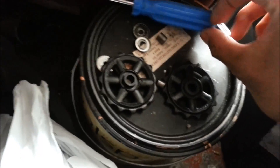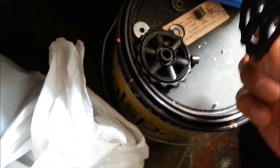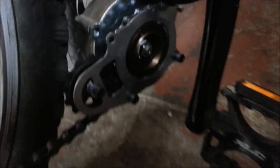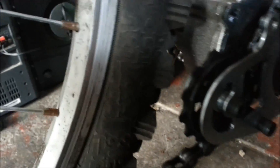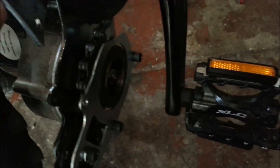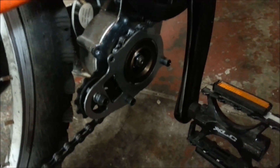I had a larger one and a smaller one. They have all the spacers and stuff, that's good. But these guys were too big. There's a straight one and an offset one - the offset one might have come in handy. Anyway, these were too big so I went with a smaller one, and it is almost touching the sprocket but it doesn't, and it doesn't slip as much.